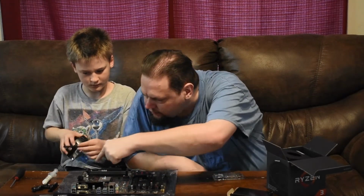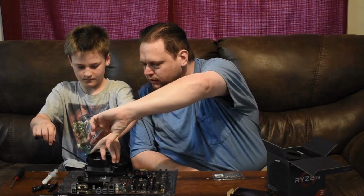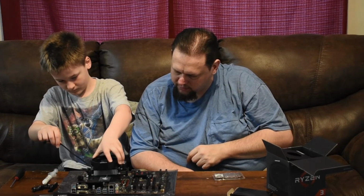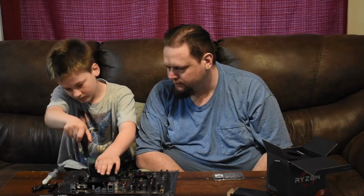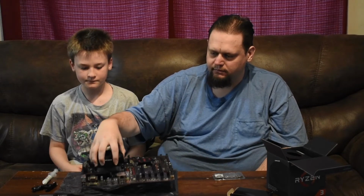And it's going to plug in right there. So, nope. Probably that way's the best way. Just line it up over it and put it down on the... Oops, you don't want to be doing that, so... There you go. There you are. Alright, and then you hold it steady with one hand and you screw in with the other. Screw with purpose. Alright, and it's in place, so we're good. Alright, and then the last part of the CPU cooling unit being connected is to plug in the power. There we are.